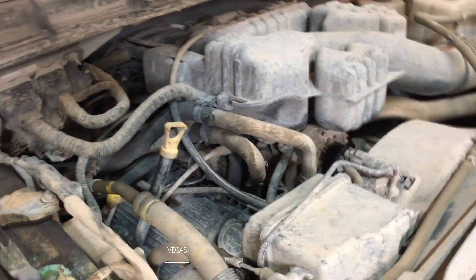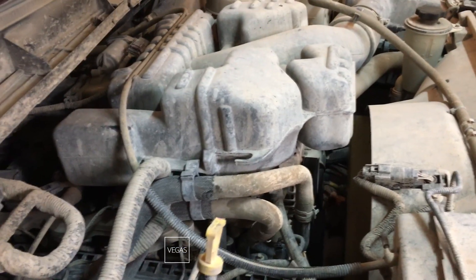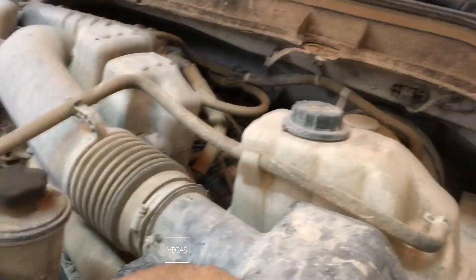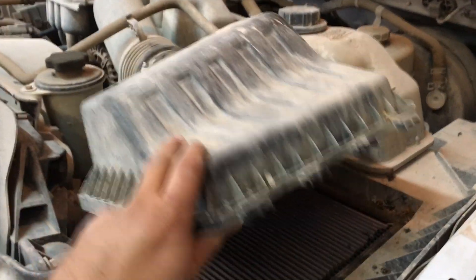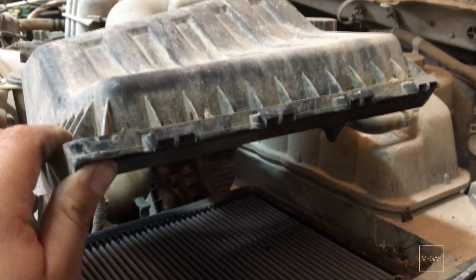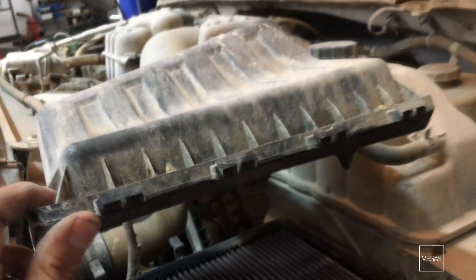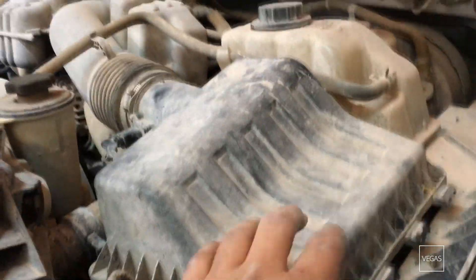You hear that? A little difficult for me to detect where that noise is coming from. Let me just open this box up to make sure it's not back popping through the intake. All right, so here we got the air filter cover off — I just wanted to see if that noise was back popping through the intake. It's pretty evident that the noise we're hearing is back popping through the intake. So we definitely have a pretty bad misfire.